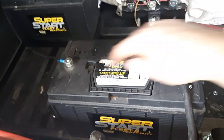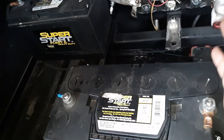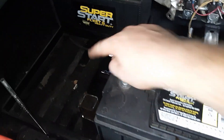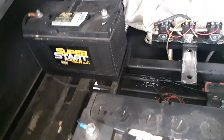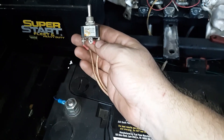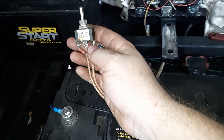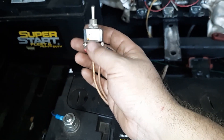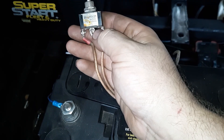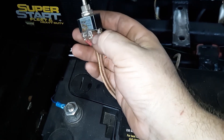Like I said, this is all a big cycle, a big loop. So we just got to figure out what wire it's coming out of - it's going to come out of a positive wire and go to a ground, basically is how it goes. So we're going to come out of our power wire here - this goes to our switch box. Think of it as this: this goes to our switch box. On a switch, the center is always power, unless you've got something weird going on. Your power is in your middle, and then whatever switch you want - whatever pump or dump you want to go to - you're going to wire accordingly.